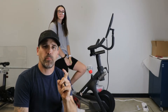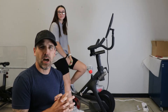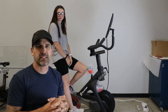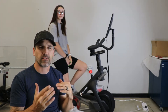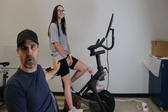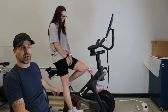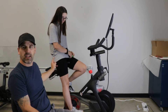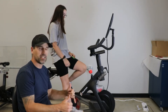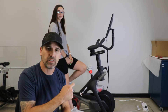We just had Peyton on the bike. Now Peyton and Madison are basically the same height — 5'4.5" and 5'5" — but you'll notice a vastly different fitment. That's because they carry their height in different locations. Madison's height is mostly torso and less leg, while Peyton's is more leg and less torso. You can see down here there's a full knee lock and a little hip roll because the leg extension isn't the same. We're going to adjust the bike to make a proper fit for Madison.